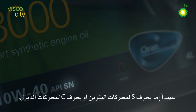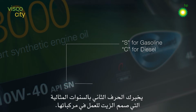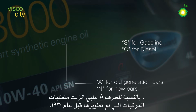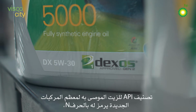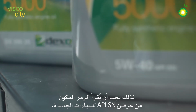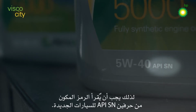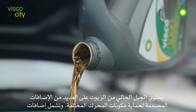It will begin with either an S for gasoline engines or a C for diesel engines. The second letter tells you which model years the oil is designed to work with. For the letter A, the oil meets requirements of vehicles that were developed before 1930. The API classification of oil recommended for most new vehicles is N, so that the 2-letter code should read API-SN for new cars. The current generation of oils have numerous additives designed to protect various engine components.